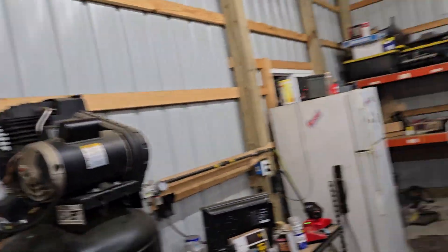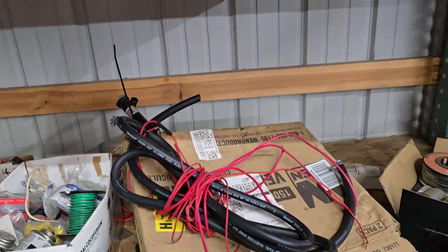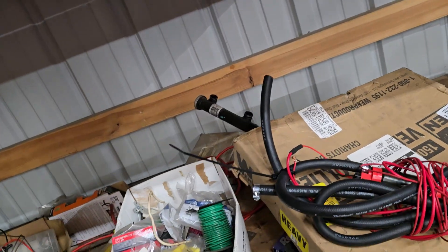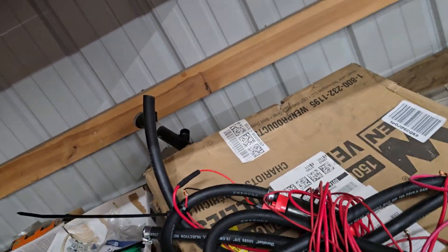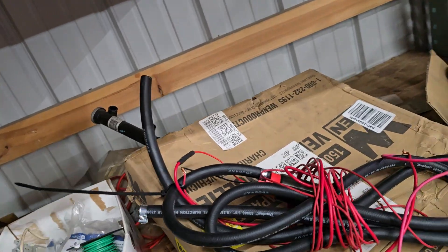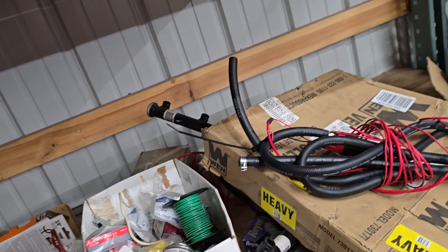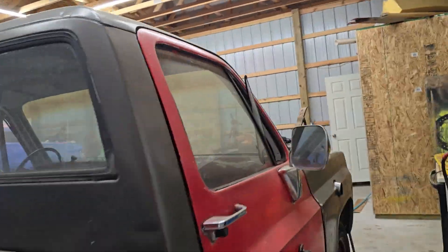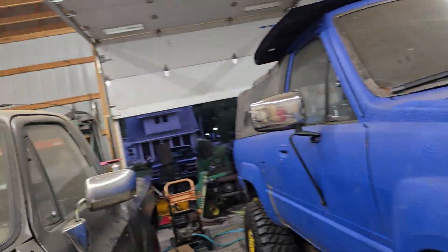I used to use ChemSail pumps — they're an off-brand you can get on Amazon and eBay. Nowadays I use the Evil Energy pump because those went up in price a little bit, and that's the only reason. This is supposed to be a 340 liter per hour pump. It's more than enough for an NA LS, more than enough for a basic turbo with a set of 80s trying to make 500-600 horsepower. Zip-tie this in your fuel pickup, run your line up to your rail, and you're done. That regulator will regulate everything for you. Put a filter in line — Shitbox Supply has them, Evil Energy has them, put it wherever it's clever.